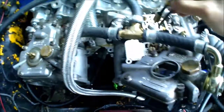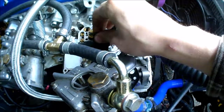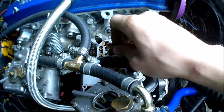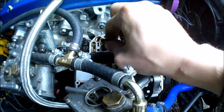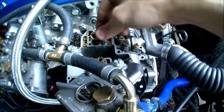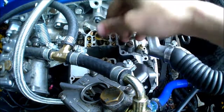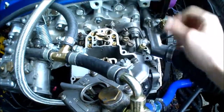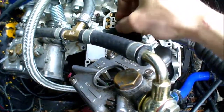It's raining now, but I'm going to explain why I'm having so much hesitation. This is my accelerator pump, and it was pretty much stuck all the way down. It's feeling a little bit better now - I've been scraping it this whole time. Once I can get that cleaned out, no more hesitation, and it actually should run smooth so I can actually drive it.